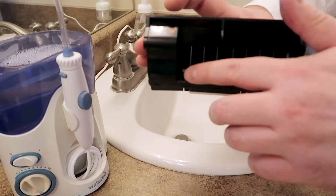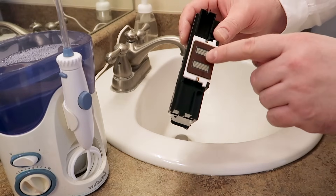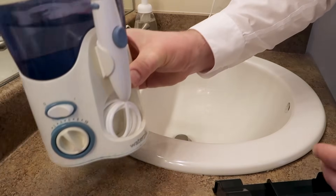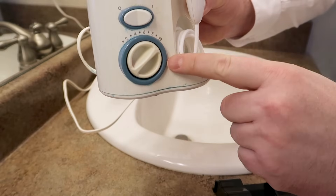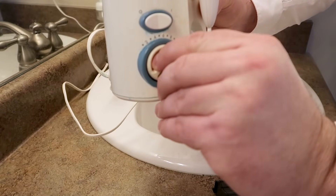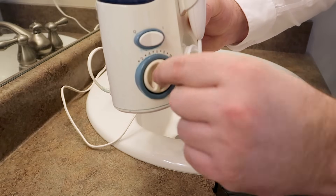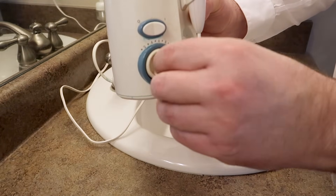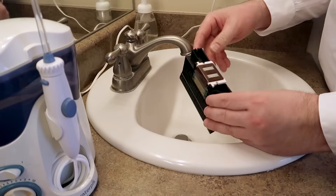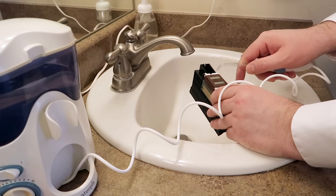You want to keep filling the liquid up as it's sitting there soaking — I had it up to about that level. I didn't go up onto the contacts. You just want to make sure that the nozzle area is submerged. On the water pick tool, you have this dial and you can crank it up to 10 — I've actually cut my mouth at about seven, totally bleeding everywhere. I keep it at about two or three for cleaning the printhead. You want to make sure you're doing this in a bathroom because you get some spray, and you don't hold it directly on the printhead.